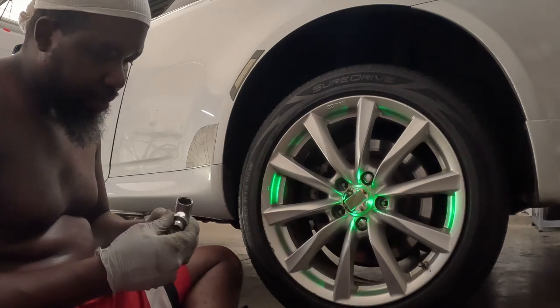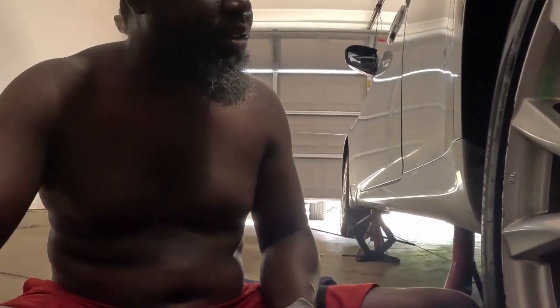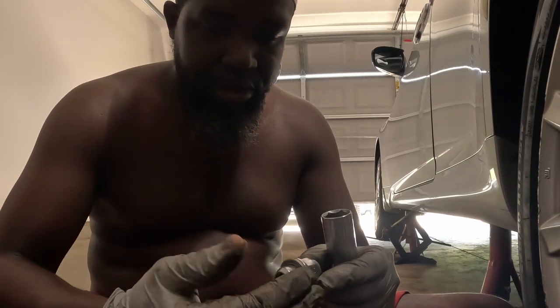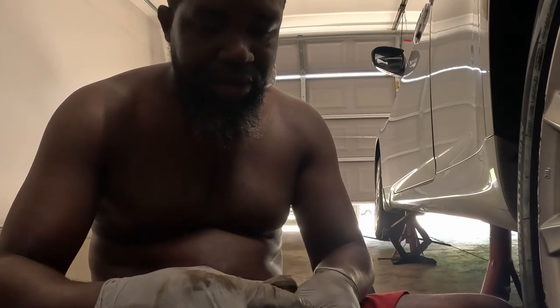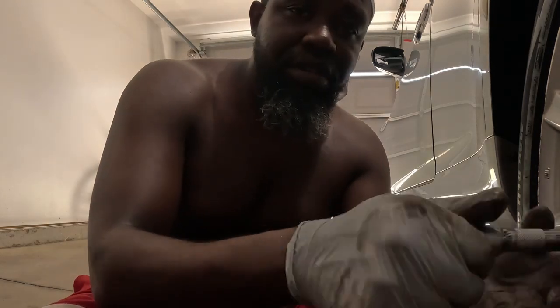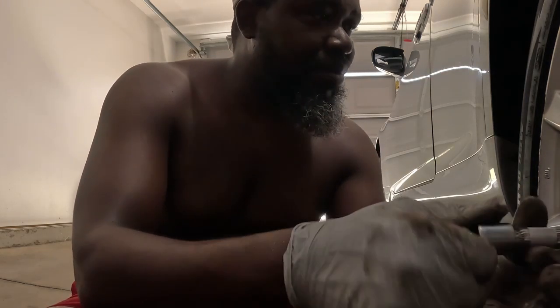So, I'm telling you a little secret. When you buy tires, they sell you new tires. Yeah, they new. But everything got its expiration date. So does rubber. They might sell you some tires that'll be almost a year old. You don't want that. In two years, you get them dry.